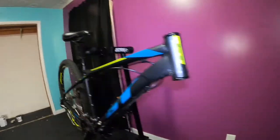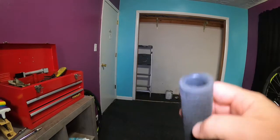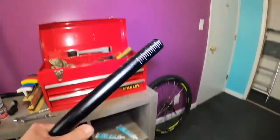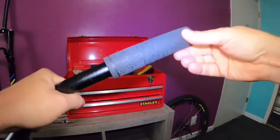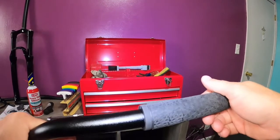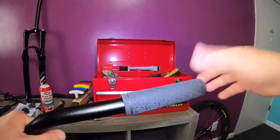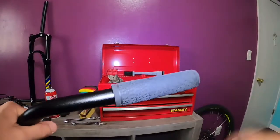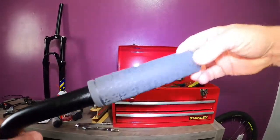A trick I learned over the years when you want to put grips back on - you don't have to grease it up or anything like that. I just breathe into it a few times, get some moisture in there, and you can just pop them back on. You don't have to worry about them taking too long to set and your grips moving. That's a trick I learned about 25 years ago. On my dirt bike and four wheelers I use clear spray paint sprayed down in there - it sets in place, dries up, and gives it a grippy feel so it doesn't move. I don't like wiring them in place.